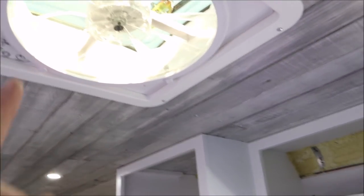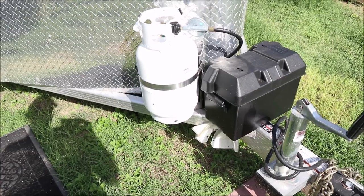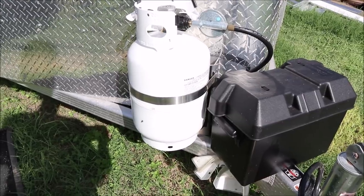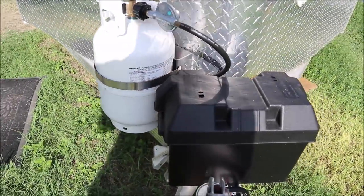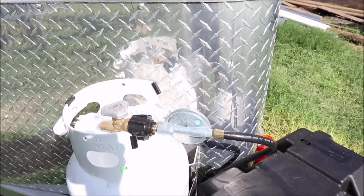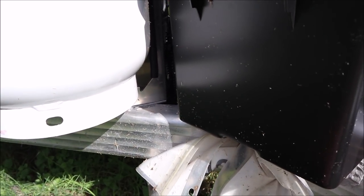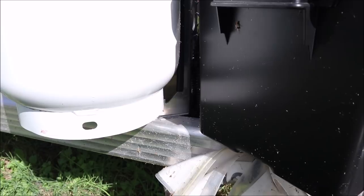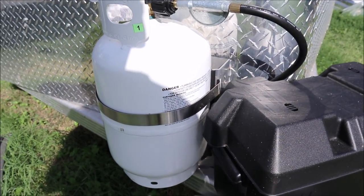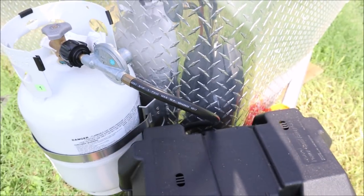Both fans are wired in. The electric comes in from behind the fridge right here and feeds the power box, which is right next to it. Here's the LP tank and the battery — I'm not 100% sure if that's where I'm going to leave the battery, but for now it's going to stay there. The tank runs from here straight up underneath the nose and right up to the center of that cone and straight to the water heater — very simple. I just had to use a couple of little adapters to go from the flexible hosing to that yellow hose on the inside.